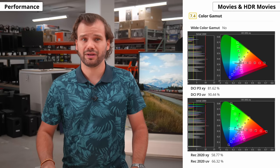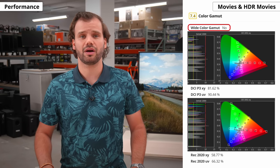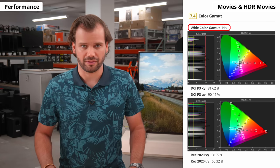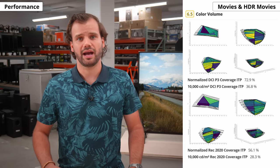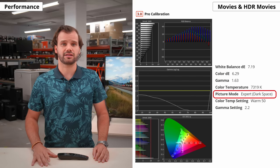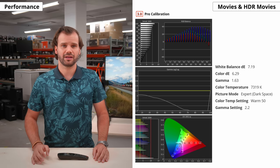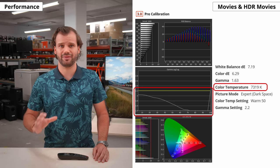If you watch a lot of HDR movies, it's important that the TV has a good color gamut and color volume. Unfortunately, this is one area that is a downgrade from the previous model. The color gamut is narrower and doesn't cross our threshold to be considered wide color gamut. The color volume is also a downgrade — it has trouble displaying dark colors because of its low contrast, and struggles with bright blues, which is typical for LCD TVs. The tone mapping is really off because our unit is not well calibrated out of the box. In the expert dark space SDR picture mode, white balance and colors are visibly inaccurate — the image has a slight bluish tint and the gamma makes everything too bright.